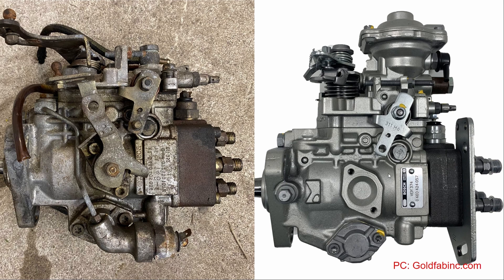We'll see what we can get away with. At the very least I'm going to try to reseal it — these pumps tend to start leaking around the rotating parts, things like the throttle and this main shaft. A reseal kit is pretty cheap. What kind of upgrades and deletes I get to do — hey, that's anybody's guess. But we'll be shooting for what I'm showing here with this 4BT pump, and if not, well, we'll just have to live with it.